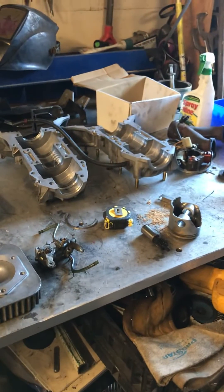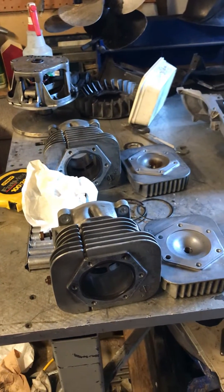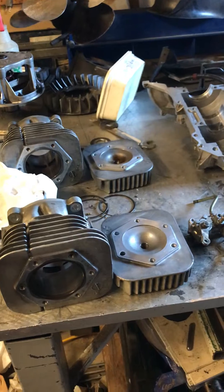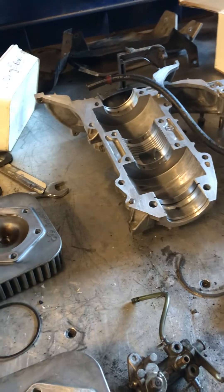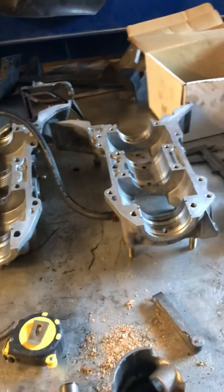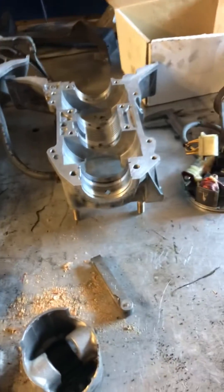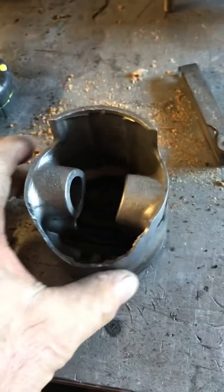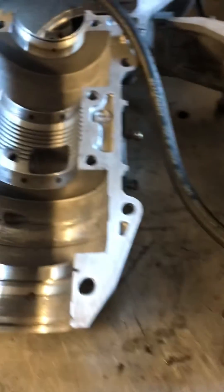There's one more project that I'm currently in the middle of. I picked up a snowmobile from a friend of mine in Skookumchuck. They said the crankcase needed to be replaced by the service guy who did his inspection, but the crankcase is okay — the crankshaft had a bad inner bearing, probably because it ingested some of the piston that had failed.